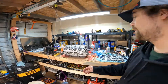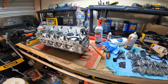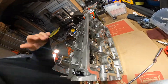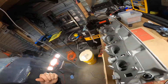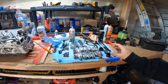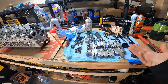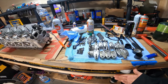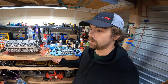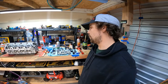For this video, I think that's going to be it, guys. All my cameras are dead — I haven't been home for the last three days, been helping my pops out. I'm going to go ahead and spray some WD-40 on this rocker assembly, wrap it up in a bag, and call it a night. For all of the cam caps and everything — these are aluminum — I'm just going to take them home and wash them in some hot Dawn dish soap and use a toothbrush to clean them up. No need to worry about rusting or wasting a bunch of parts cleaner. They clean up perfect with just some Dawn dish soap.